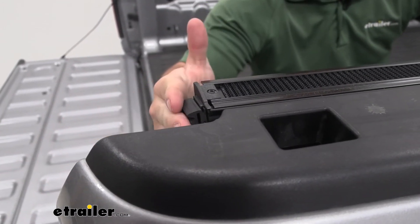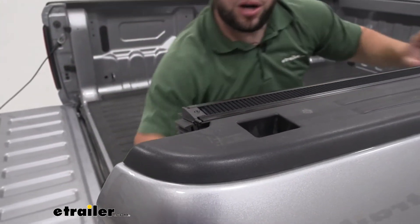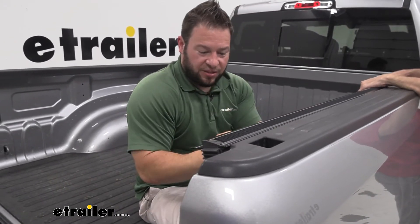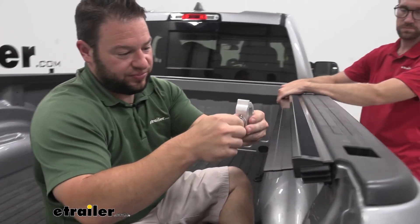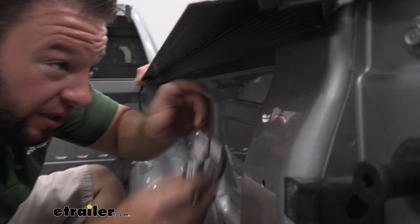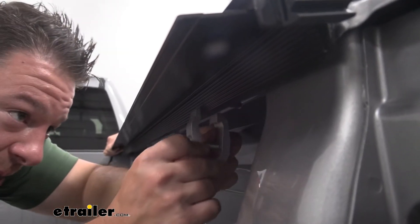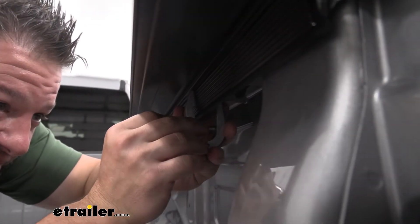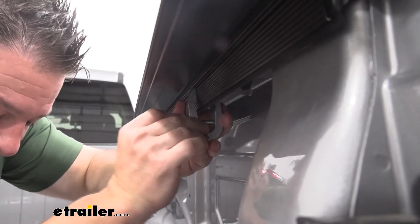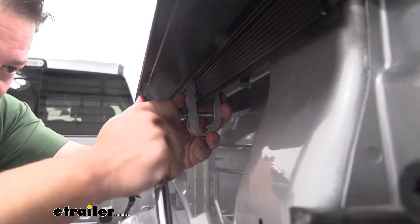This is going to help you when you go to close the tailgate — you want it centered in between. So take a look at it, looks about right. While he holds it in place, I'm going to take one of the clamps and attach it. You're just going to loosen it like this and it separates. Put it up and match those teeth with this section — it's going to pull this against the top of the truck bed and hold it in place. I'll start to get that hand-tightened and come back with a ratchet to tighten it down just a little bit more. Don't fully tighten it just yet.